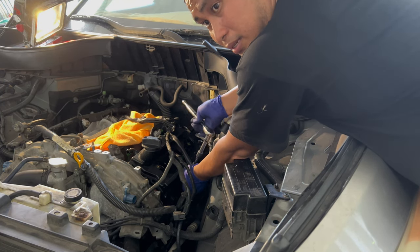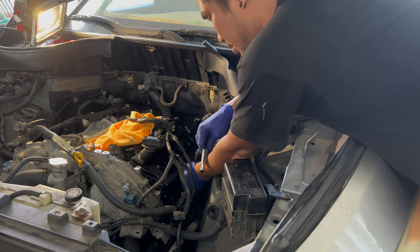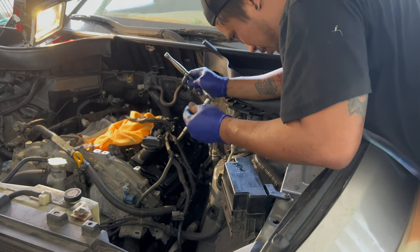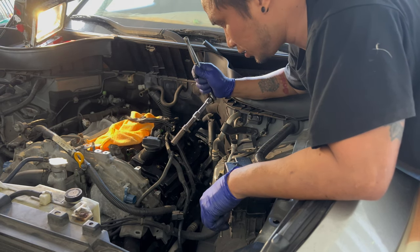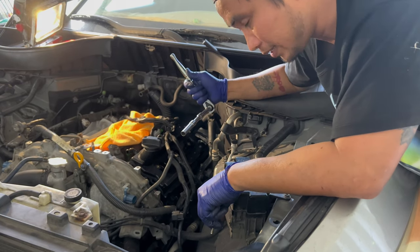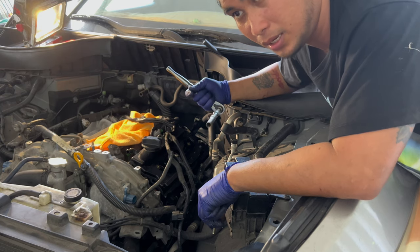Even on this cam position sensor seal, you want to put a little RTV just so it holds in better when you apply it. The grommets around this are still good — I checked it. We're not going to put crazy amounts of RTV all over because that's not what the gasket's for. We're just going to put it on the corners and on the part that meets another surface — metal to metal or a weird shape. I'm going to put it very sparingly — not too crazy, just little dabs. There is a tightening spec sequence — torque it by spec so it's at the right tightness.